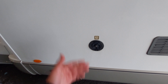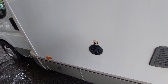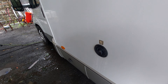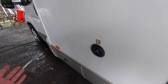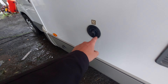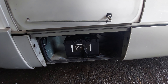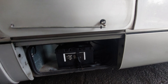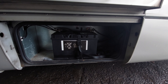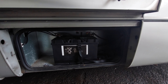I personally wouldn't recommend driving with a full tank of water due to your payload and weight distribution — only fill this up when you're on site. When you're filling it up, ensure all your drain-down points are closed, mainly your fresh water tank, to avoid any water draining outside the vehicle. Finally, just to conclude on the outside: following on from the fresh water, your leisure battery is located in this locker here, so if you ever need to replace it, it's nice and accessible.